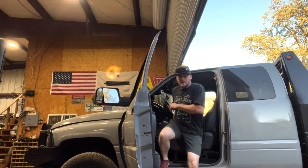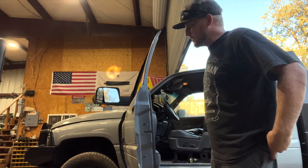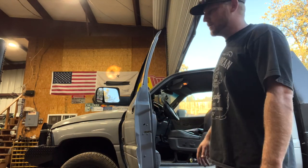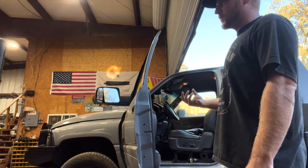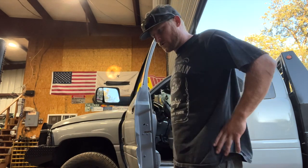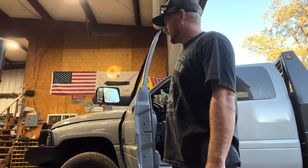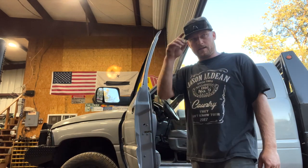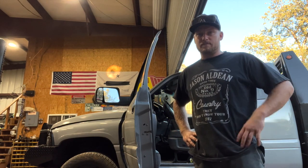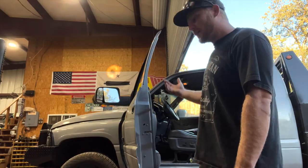You know what's really funny about that? When I put all the wiring back together on grandma's truck and went to fire up the new engine, it wouldn't start. I was chasing wires, checking all those switches. Come to find out it was one of those crimp connectors — the end of the original starter cable wire was all kinds of destroyed. So I put a new end on it. Well, it's been about a year since I finished the truck, and it just started giving me those issues about a month ago. That video where it left me hanging — I haven't driven it since because I just didn't trust it. And it ended up being that.